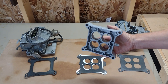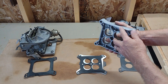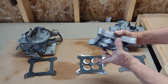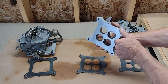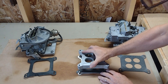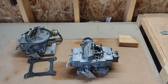Then we have this authentic Ford 1-inch spacer from the mid-60s. It's meant for Ford carburetors and a Ford intake manifold. If you remember the Edelbrock, this is much wider between finger and thumb than it was on the Edelbrock — that is why this piece exists. It has a nice big flat surface against the intake manifold. Another gasket seals up the bottom of this one-inch spacer, and on top of the one-inch spacer goes another gasket. And I can verify that that works — there are no vacuum leaks, no problems whatsoever.